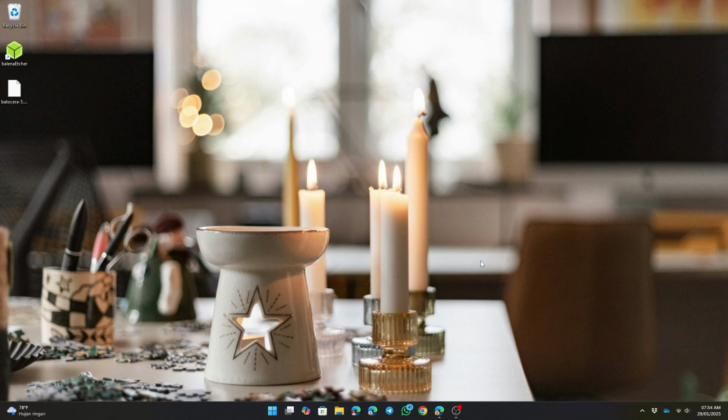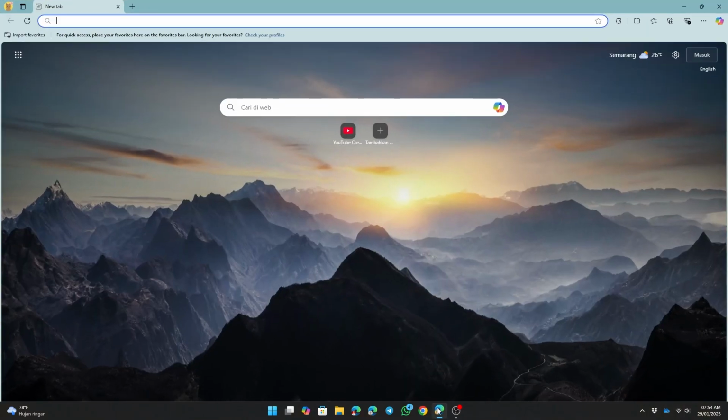This time, I will discuss how to turn an Android STB with Amlogic S905X chipset into an Armbian desktop. By using this operating system, the STB can function like a Linux-based computer. The installation process will be done via SD card, and I highly recommend using a Class 10 SD card to optimize the performance of Armbian desktop.